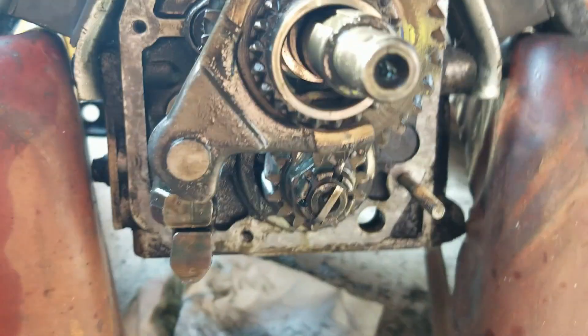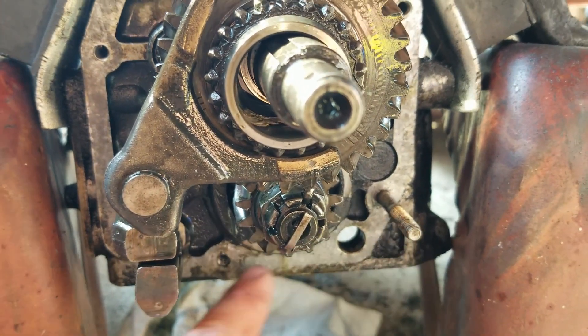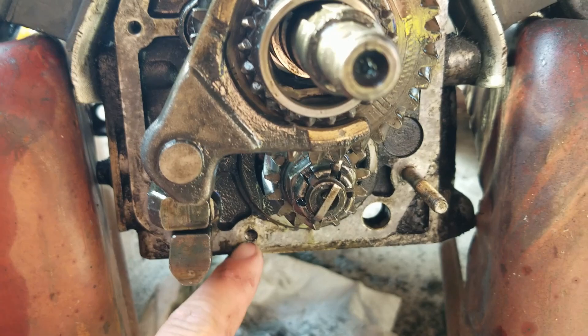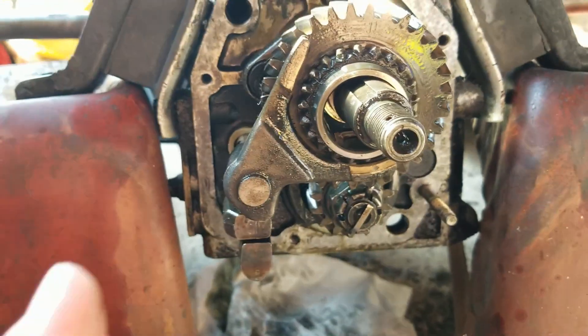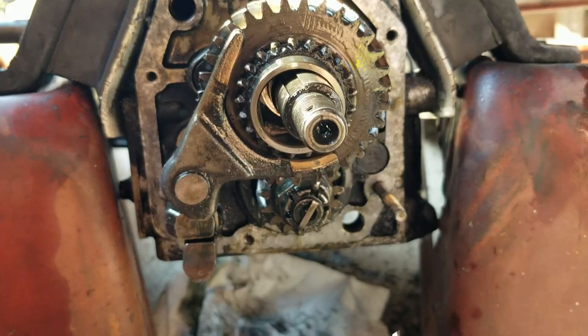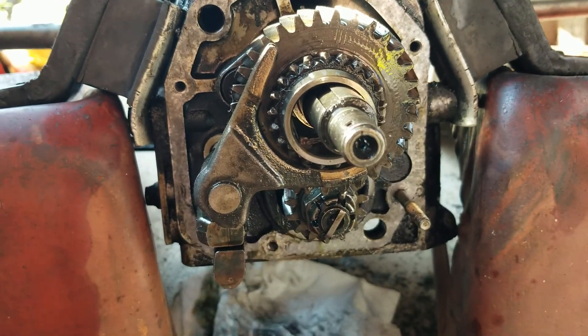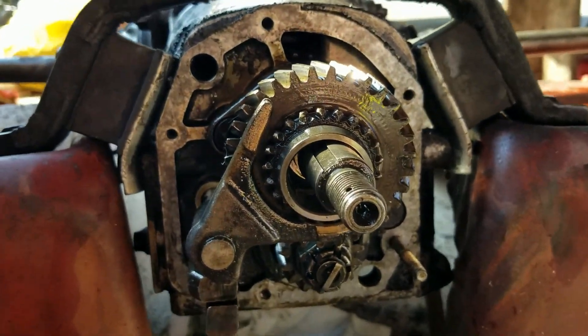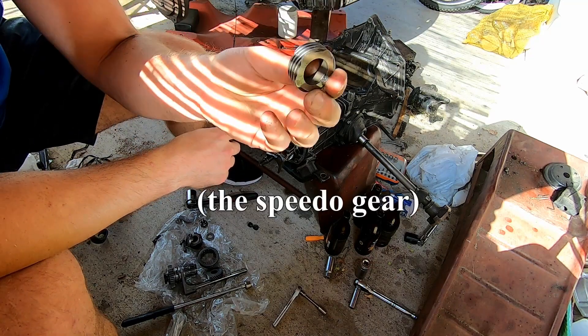Take a 7 millimeter drill bit to right there - there was a stud in there. Take the stud out. It's okay that you're not going to have the threads in there anymore, because the threads are going to be on the new housing that you put on. That side is going to bolt from the other side. Drill it with it upside down so the filings will fall down and you're not going to get any little metal bits up in your gears. This is what it should look like once you're finished modifying it.